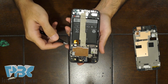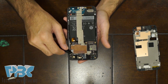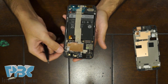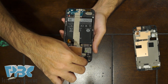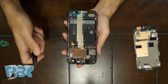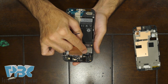Then you can disconnect your power and volume key cable right here, right next to the battery cable. And then you have this white cable on the top of the board — disconnect that by pulling it up. Then you've got one black cable right over here on the left, disconnect that also. And then you've got this piece in between the front-facing camera and the rear-facing camera — just lift it up, it disconnects from the board like so.